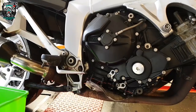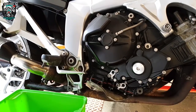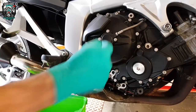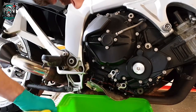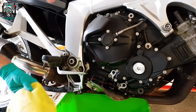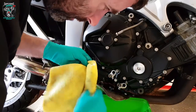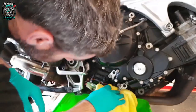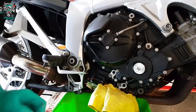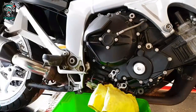If you're doing one yourself, you don't need to worry too much about losing oil. With it on the side stand, most of the oil is over that side of the engine. Just put a tub underneath to collect the worst. There's a heat shield on the bottom — you don't want oil gathering in that, it's a pain to get out. So just stuff some rag to collect what does dribble out. There'll be a bit, but there won't be loads — you won't lose all the oil.